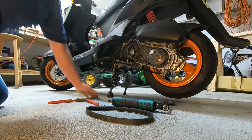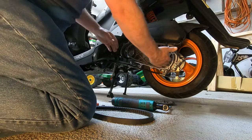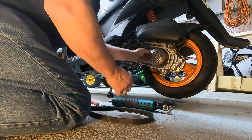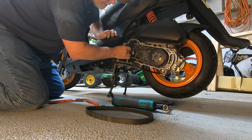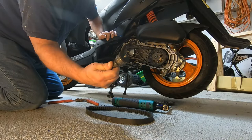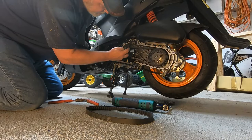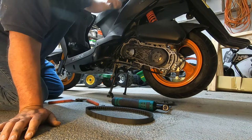This one doesn't sink down into that pulley much. Let's see if I can get my other hand back here to grab the pulley to pinch it. Let's use some brute force — yes! You gotta pull this pulley out now so you don't have to worry about that. Now to put it back together — put all this back on there. This gear has to go into the splines on the drive gear, the pulley. I guess you'd call it a drive shaft.